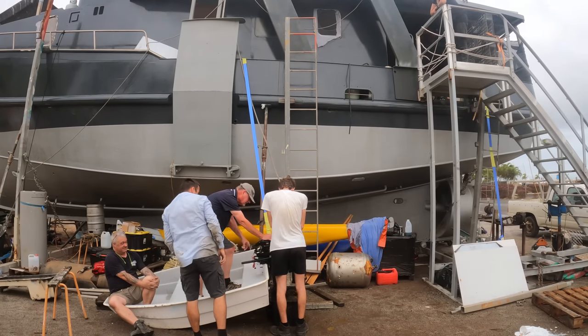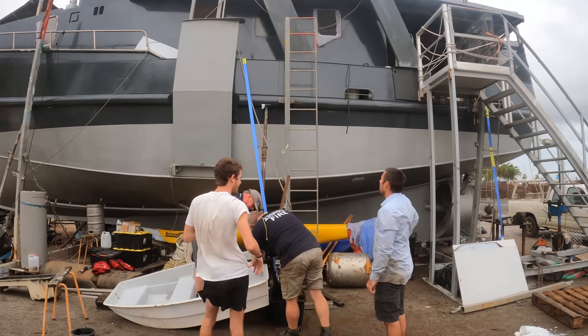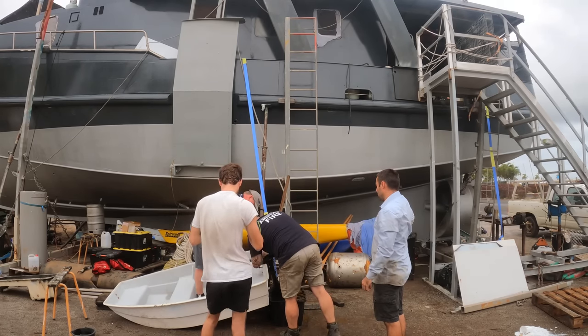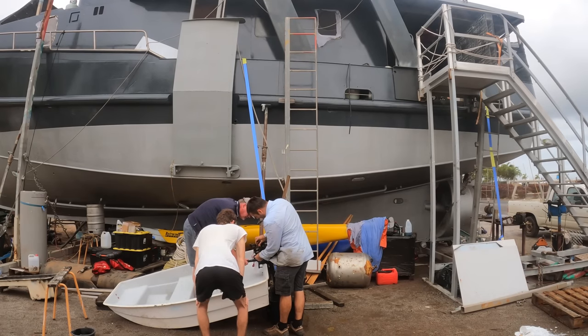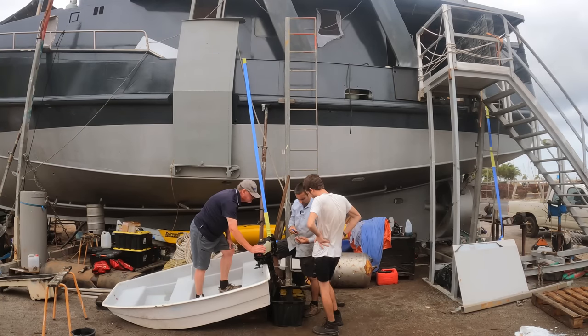Oh, there's the throttle stop. Oh, there we go. The throttle stop down again. Trying. There's definitely fuel coming out here. Yeah, there is. I was just thinking, I wonder if the carburetor's got petrol gum in it. I'm wondering if the float is jammed with old gum and residue. If we can just undo that bowl. I was expecting to see much worse than that.